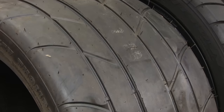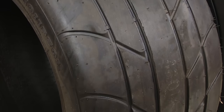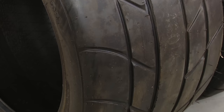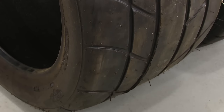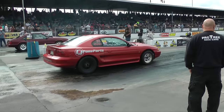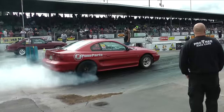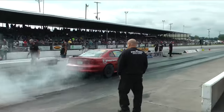Now if you have a drag radial, it's a little bit different. Drag radials are designed to work at a lower pressure. Whatever diameter the wheel is, that's usually where I start — a 20-inch wheel, I start at about 20 PSI; a 15-inch wheel, around 15 PSI, and so forth. If you're running a full-size front tire, again go around the water box, don't drive through it. But back up, get some water on them, and these you want to do a burnout with. A drag radial has to be hot or it's not going to work. You just drive up with a cold tire and it's going to spin just like a street tire. But get these nice and hot and drag radials can be very effective.